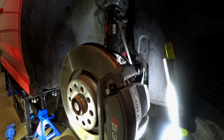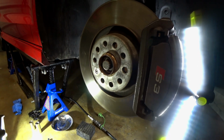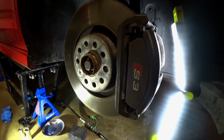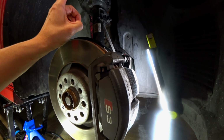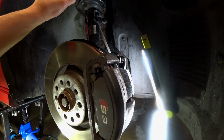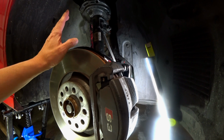And for you guys who actually removed the axle bolt, you want to go ahead and torque that down to 125 foot-pounds. Now if you missed, up on top there are 3 shock to chassis bolts. Those are going to be 11 to 12 foot-pounds. And then again, the shock top hat itself is 44 foot-pounds of torque.